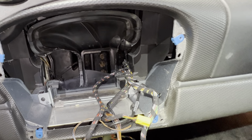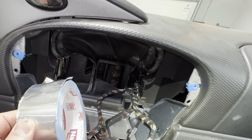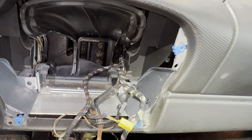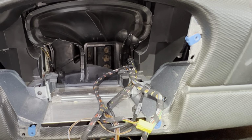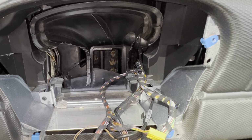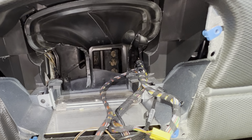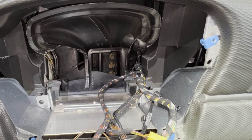Now, I did want to quickly acknowledge that there is another way of doing that, and that is to use this aluminized tape to put it on the blend doors instead of those plugs. I don't have any evidence that these plugs are better than the tape. They just seemed like a little more precise solution and something I wanted to try. Unfortunately, the plugs are not quite properly sized to perfectly snap in place and give confidence that they would never come out. That's why the RTV's there.